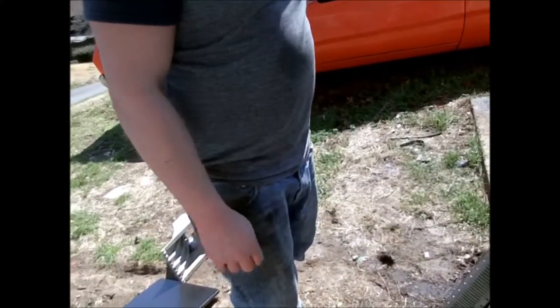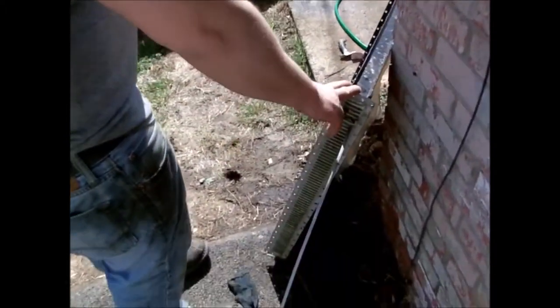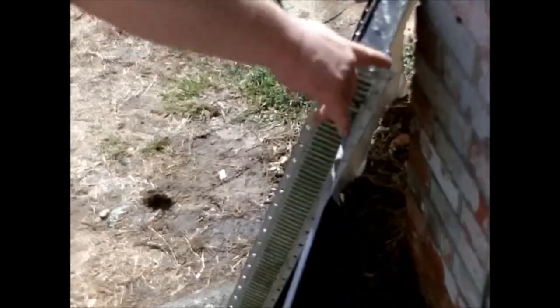After I'm through, I'll probably boil some water, turn it upside down, and just dump boiling hot water through here to try to thin that oil out. Then I will put the tanks back on and bolt them down. I could not get gaskets for these tanks, so I just had to end up making some out of rubber cellulose gasket material from Fel-Pro.